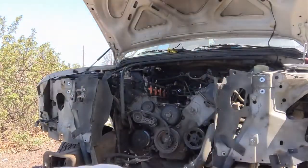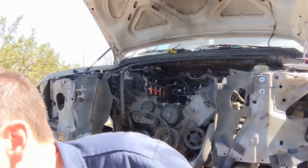What else? The fan is, you know, couple of whacks with the hammer. It was 48 millimeter for that. Really not much. Not much that you're dealing with. The EGR pipe, you just need to disconnect it from the top. You do not need to disconnect it from the exhaust manifold, at least at this point. We may in the future, but right now, just off of the EGR valve itself is all that pipe needs to come undone.